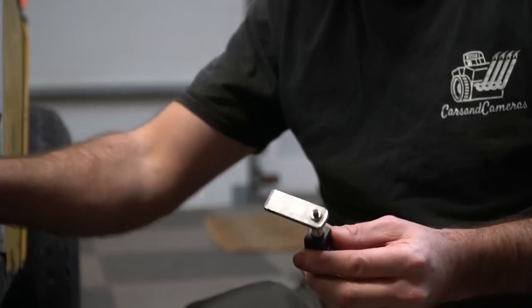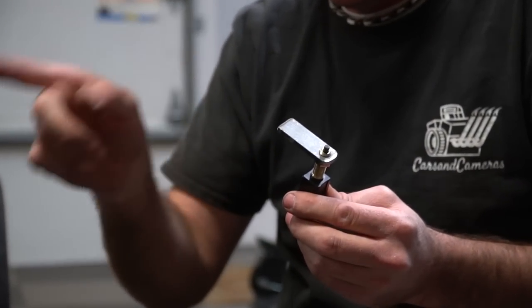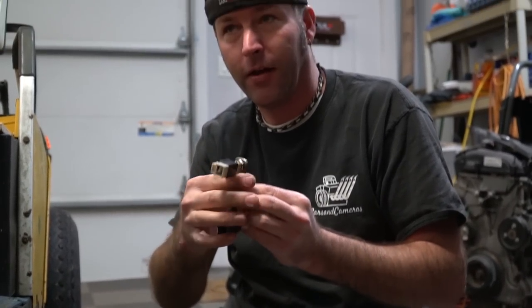What I have is a bracket made from some Go Power Sports pieces that I have modified. I'm going to weld this to the brake lever and then run the wiring. Every time you hit the brake, the lever moves away from the body, releasing the button and breaking the contact for the wires. On this particular switch, when you release the button, the circuit is closed, allowing the lights to light up. Some switches, when you release them, open the circuit and you lose power. All it is is a switch inside making and breaking contacts, allowing current to pass through or not.